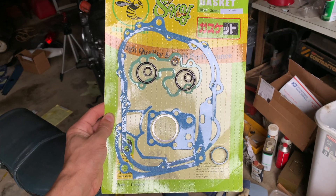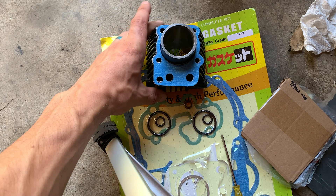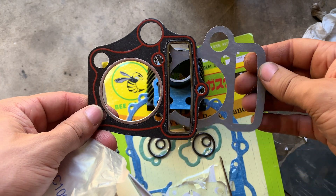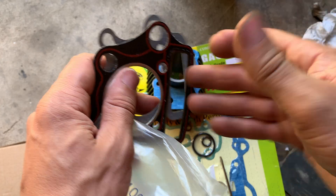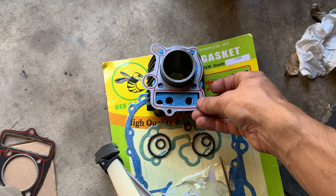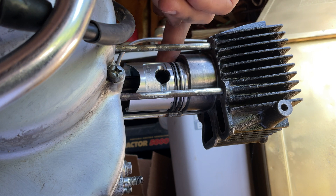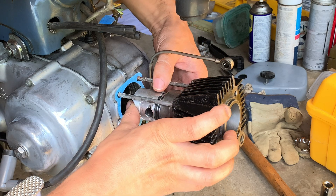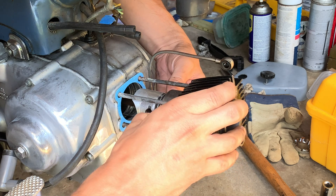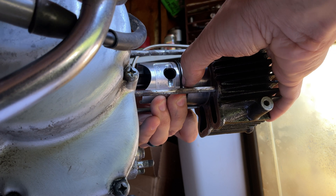Now it's time to open that C100 gasket kit, which looks suspiciously incomplete but actually isn't — it's just what I needed. I bought some extra gaskets on eBay as a last-second combined shipping impulse buy. These are labeled as C100 gaskets, but notice the cutout for the cam chain. You can see how much bigger the cam chain head is. The cylinder's already been oiled, but I'm adding oil to the rings so it slides in as easy as possible, and as I hit the top ring I'm pushing in on the sides of the rings as I push the cylinder over them.